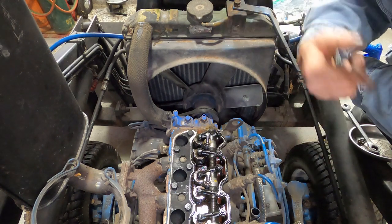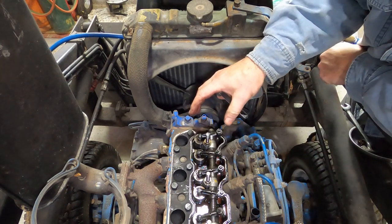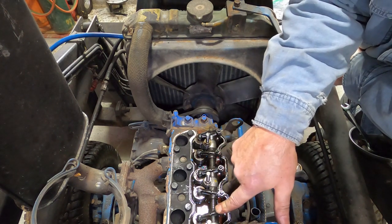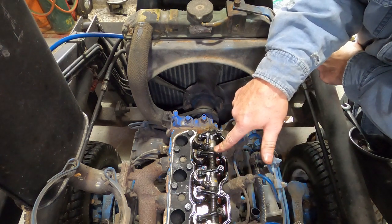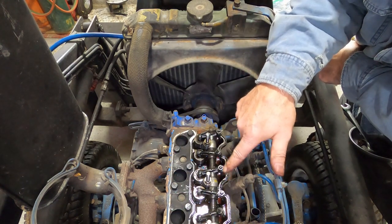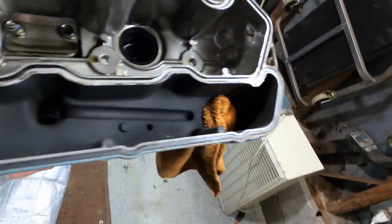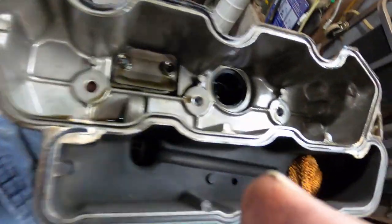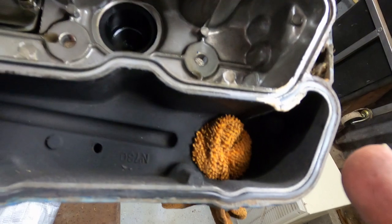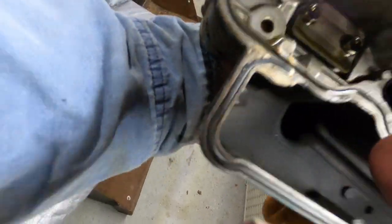I'm not going to take you through the rest of this — I'm going to go around one more time to double check, then start putting it back together. A tip: with number two cylinder at top dead center, and number three intake valve open and number one exhaust valve open, you can get four valve adjustments at the same time. I went back one more time and had to make a correction to one, so I'm going to put the cover on. I was cleaning up and making sure this is the intake passage.